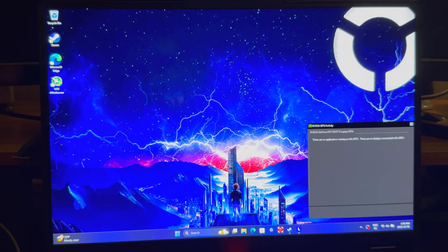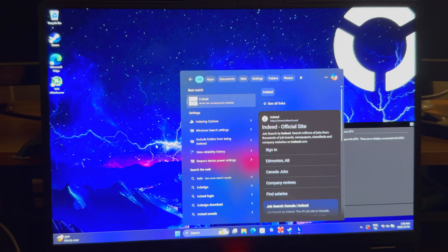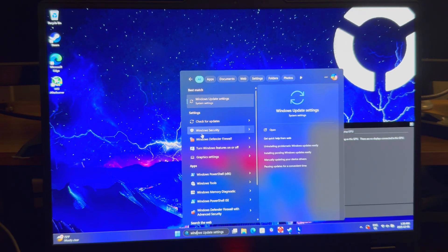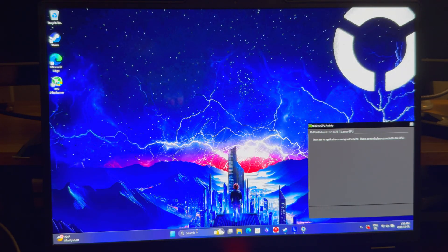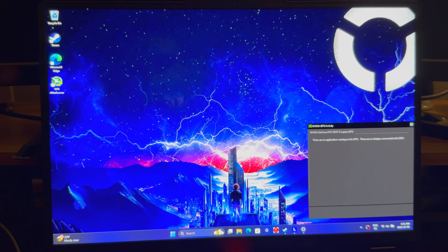Some other stuff to be aware of: when you first get a laptop and install your programs and get everything set up, it will take some time for the battery to normalize. For one thing, Windows does indexing - it indexes your files, which makes searching and doing stuff faster. That usually depends on how much stuff is on your hard drive or SSD, but it can take some time and will make your battery lower. Once it's done though, it's usually done. There's also things like Windows updates - when you first get your computer, you're going to get all kinds of Windows updates and that kills your battery life big time. But once that's done, typically it's over and you're fine. So those are the primary things for battery life. It's not a super complicated thing - once you do these tasks, it can make a big difference and dramatically increase your battery life with very minimal effort.